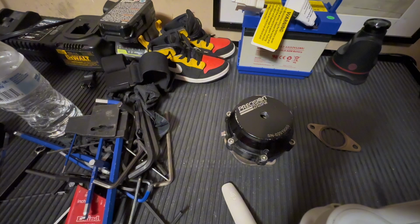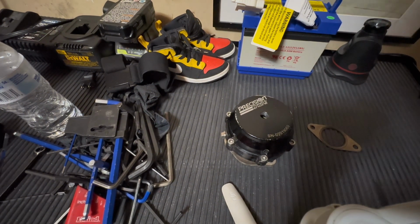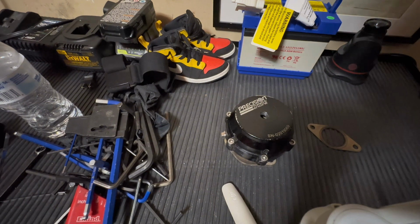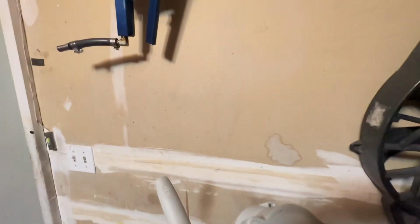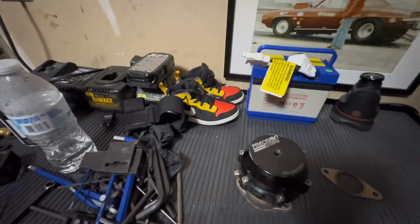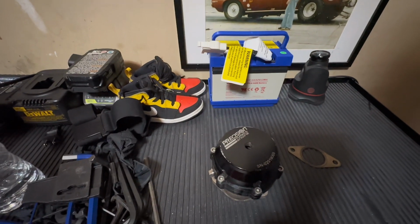Some people believe that's too small, and actually I think On3 believes these are too small because the new 9495 On3 kit has dual wastegates available as an option. So the issue I'm having right now is I'm pegging my PMAS mass airflow sensor. I took these BBK fuel lines off. I was troubleshooting, so I took it off. Got the stock SN95 rails on.